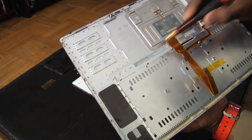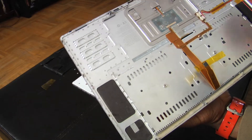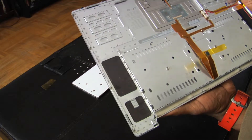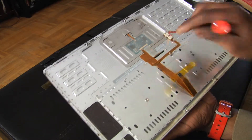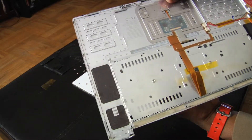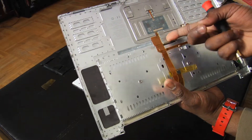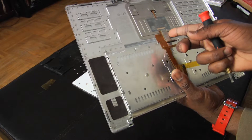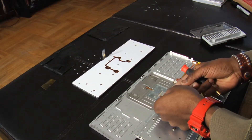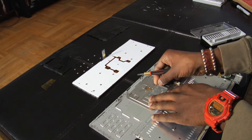Keep in mind that you're gonna have to get these little ridges back in. It's not anything serious — there are little clips to slide in, so when you put the new keyboard in you're gonna slide it in. So now our keyboard is out halfway, but this part right here has to come out so we could just pull it out. That just pulls out, but what I'm gonna do is before I pull it up, I'm gonna actually lift this up.